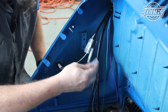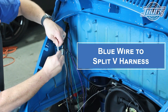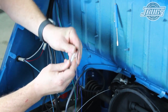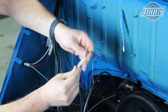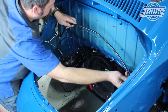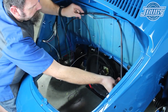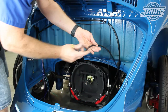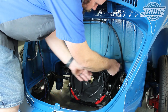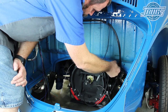The remaining taillight blue wire plugs into one end of the split V harness for the reverse lights. The middle of the V plugs into the short leg of the reverse light switch harness with a shrouded connector. The end of the switch harness is routed across the back of the engine compartment along with the long leg of the main wiring harness. The switch harness is pressed through the original firewall grommet at the bottom of the engine compartment — it will plug into the reverse light switch on the nose cone of the transmission later.